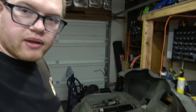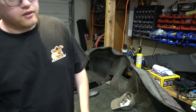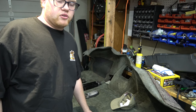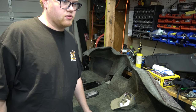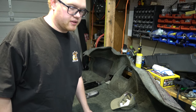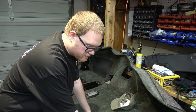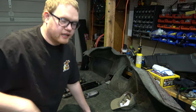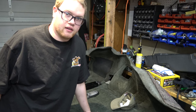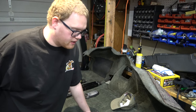In the coming weeks — I've got to wait until my next four-day work weekend — we'll be putting this carpet in. But first we're going to be tearing the interior back out of the truck, get the old carpet and whatever shenanigans I had going on, and I'm going to grind the floor down and clean it up. Ideally I would like to cut out some parts of the floor and weld in new pieces, but I don't have the right welder for that or the right metalworking tools. So I'm just going to clean it up, rusty metal primer, and probably do some POR, and maybe hit certain areas with Flex Seal to kind of seal up cavities in the floor.